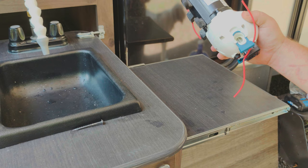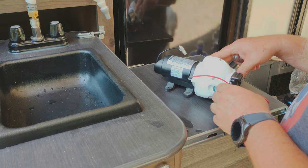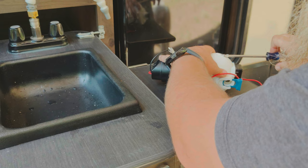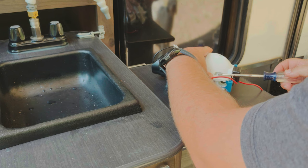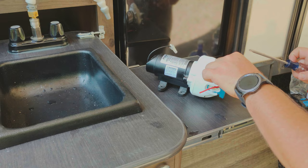Just looking, I can already see even here that there's debris right there. I brought you guys outside - I know it's hotter for me, but it's one of those things - I didn't want to have to turn off the air conditioning and sit inside a hot RV. I don't want to mess with this pressure adjustment unit here - I want to take off the whole thing because that's where the diaphragm is. This is what adjusts your pressure setting, and this pump is set at 50 PSI, which is average. You really don't want to go above that in an RV.